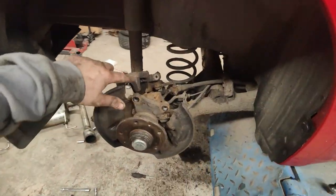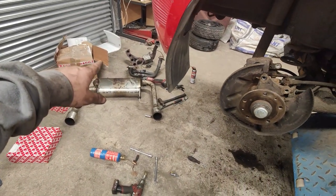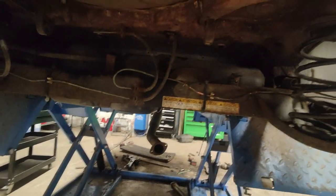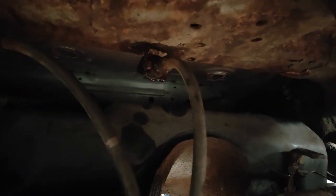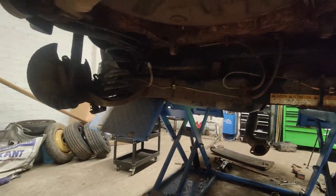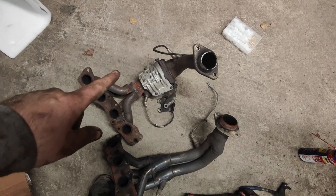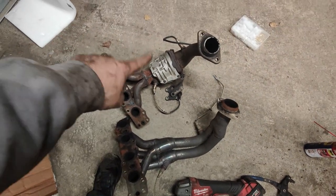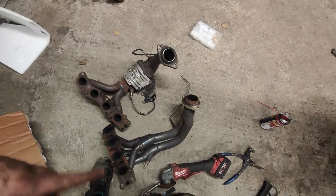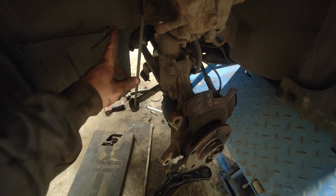The back is stripped and we haven't pushed back the calipers yet. The exhaust was a bit of a nightmare — seized bolts, but it is off. The fuel tank has been dropped to get access to the brake pipe; unfortunately because of the ramp I can't get the tank fully out without taking the back axle off, but I can access the pipe in situ. The exhaust manifold has been ordered off eBay — I actually sent them the link. We knew it had no cat when they bought it so we got that ordered straight away. Also on the opposite side: the tie bar is off and isn't even tight.